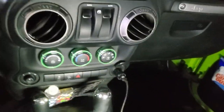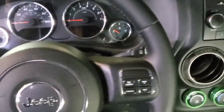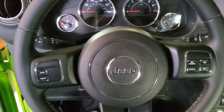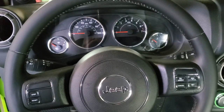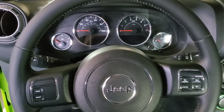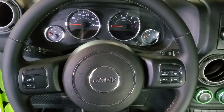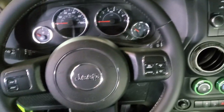What we're working on is this Jeep, and we're going to flat-tow it. He wanted to know how to do so because he's never flat-towed his Jeep — he has a tow dolly. Let's get in here. I have to use a trouble light so you can see, because it's still in the 30s today, about 31 degrees. He asked what you do about the locking steering wheel when flat-towing on this Jeep. Well, this is a 2013 Jeep Sport, and guess what? The steering wheel doesn't lock — there's not even a locking mechanism on it.